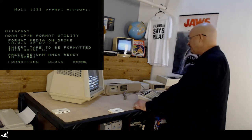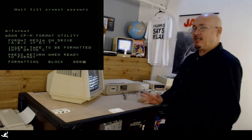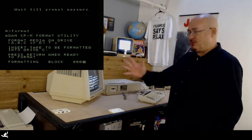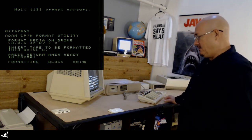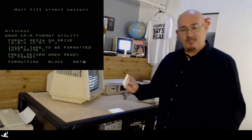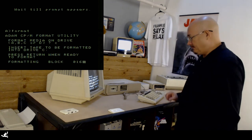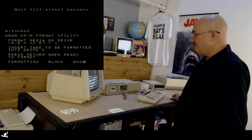Let's try another one. I have a program up in my box called a DDP verifier that I wrote — a very quick and dirty little program that basically just goes through and makes sure it can read every single block. It's nice to use on these tapes. I'll boot up on that with the DDP verifier — stick a tape in, hit enter, and it shows on the screen if the blocks are good. But I wanted to show you how formatting actually works. So far so good — this one is running nice and clean. I'm going to fast forward through this and when it's done, we'll see if it worked.